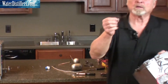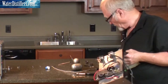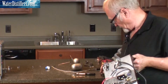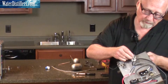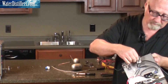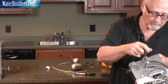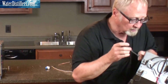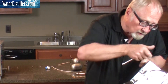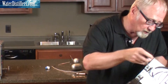Now there is a little round gasket, looks like a washer, that goes over the end here. And that's covered with a white plastic or mylar type piece. Then you put the nut on. Now as you start to get this down, you'll notice it'll start to cone over, so it kind of covers the top of that heating element. And this you don't need to overly tighten, but it needs to be snug.